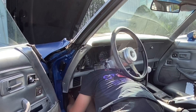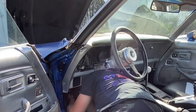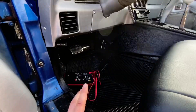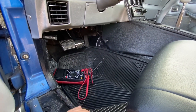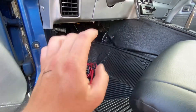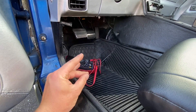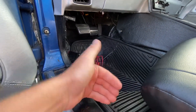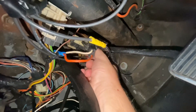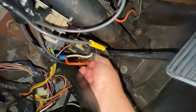Both probes are on. Now I'm pressing down the brake pedal — yep, bad switch. So I'm going to order a new one, probably Napa or AutoZone next-day delivery or pickup today. When I pressed the brake pedal it should have beeped because the circuit should have closed and put power to the brake lights. Right now I'm just removing the switch — super easy, just two nuts that lock between a plate. I'm going to test it one more time just to make sure, but I'm pretty sure the switch is just bad.